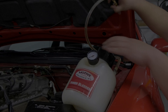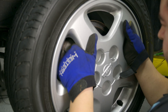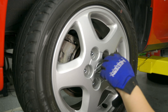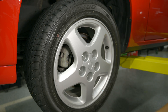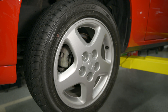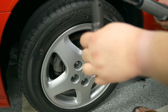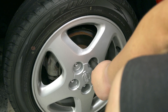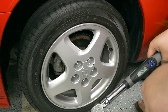Let's put the driver's side wheel back on. We're not trying to fully torque them yet. I've got the wheels on all over the car. It's time to lower the car down and tighten everything up with our torque wrench. We're going to punch up 80 foot-pounds — got 80 on the dot. Now you need to go all around your car and tighten your lug nuts the same way.